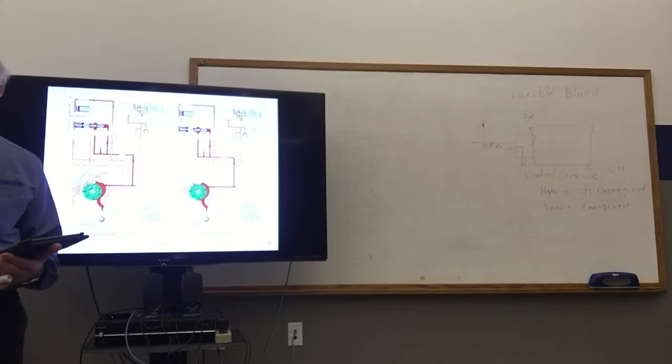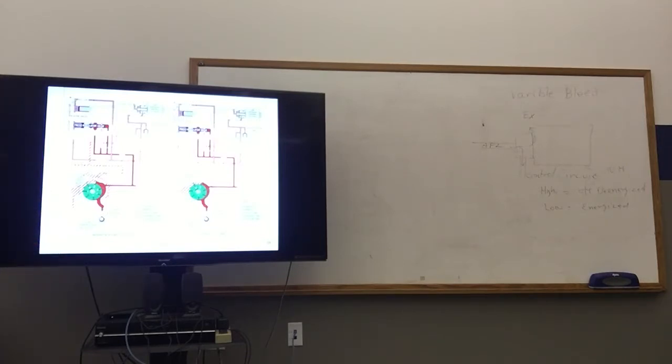Pressure can actually balloon the converter. As heavy as the converter metal is, it does expand normally — it flexes back and forth — which is why the pilot on the converter that rides inside the crankshaft has to be able to move inside that pilot hole. If it can't move when the converter expands, it's going to apply pressure to the crankshaft thrust bearings, which could lead to damage. Normally these converters expand about three thousandths, but if pressure gets too high or the converter gets overheated, it can expand more and cause damage. The blow-off valve keeps that from happening. If you start reaching maximum pressure, you're going to hear that thing buzzing in the transmission — that's your clue that your pressure may be getting too high.